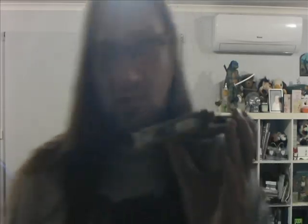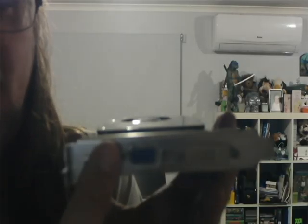I've got the graphics card here, haven't installed it yet. It looks really good — it's got DVI and HDMI. One of the reasons I really like this one is it's got these old school 3D models on it. It's a GeForce GT240, which is a little bit weaker than the 8800 — essentially about an extra 50MHz here and there. It should be using less power too, since the 8800 needed a dedicated power connector, whereas this one just plugs in with the PCIe slot. I might be able to overclock it and get a bit more performance out of it.